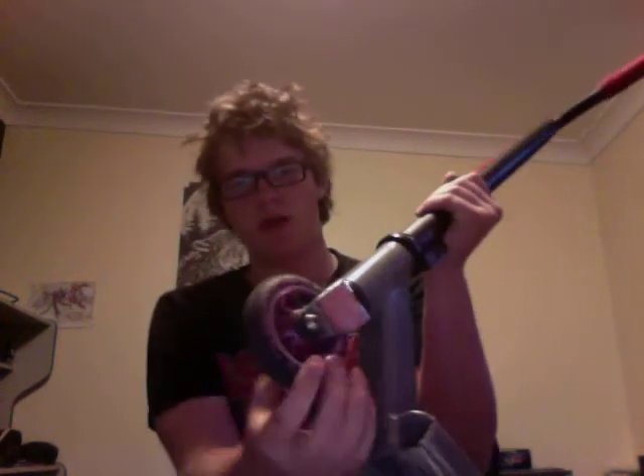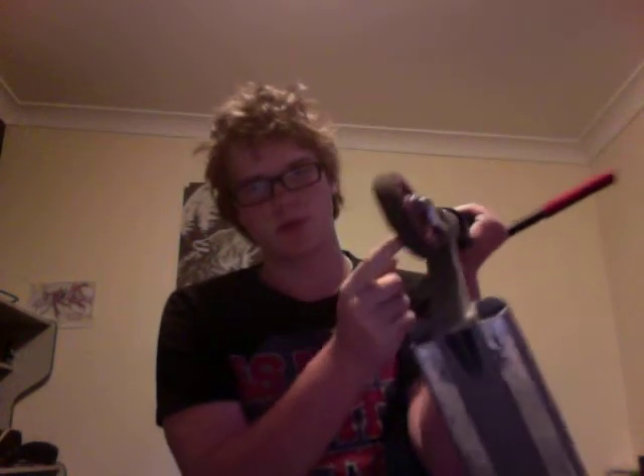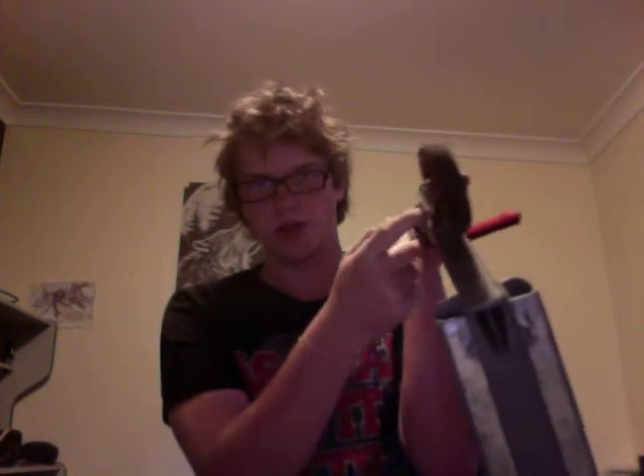I rode over from school one day — this was a couple weeks ago — and I was riding and the headset clamped up; I couldn't move it. So since it's a threaded headset, I thought it was breaking, so I couldn't move it and I just full-on twisted it, and all the headset bearings fell out of the bottom of the forks because they aren't sealed. So you can actually see the bearings, and now there are no bearings in my scooter forks anymore.